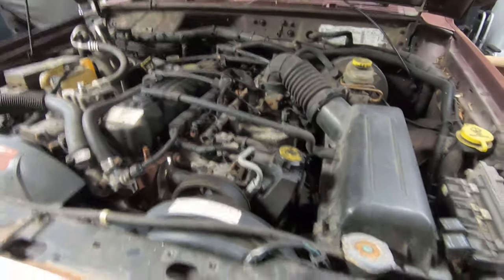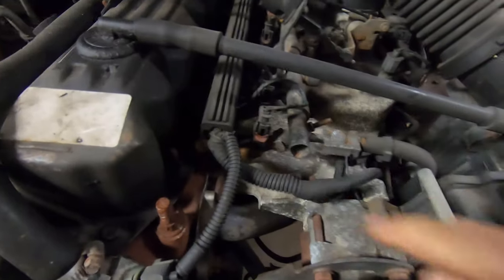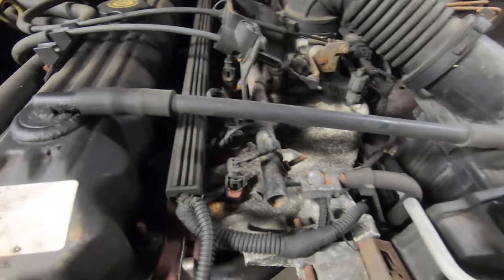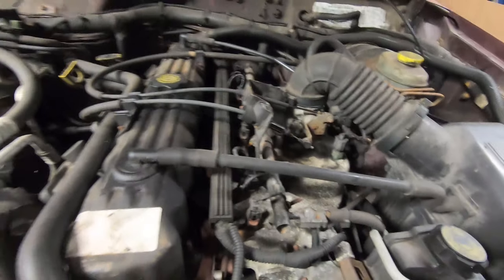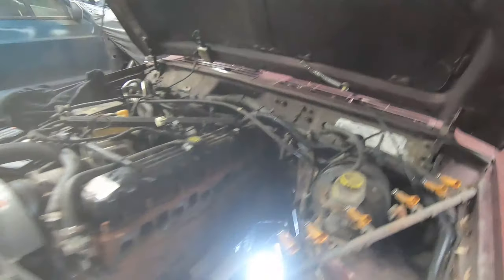It's leaking. So we have the stock manifold, and we're gonna do that. Also, our injectors are leaking from the O-rings, so we're gonna swap out the O-rings in the injectors since there's nothing wrong with our injectors. Woo, look at that naked block. We got our beauty off.